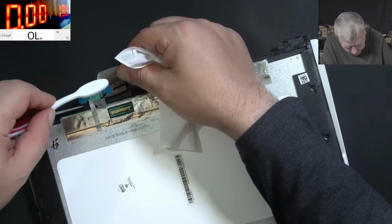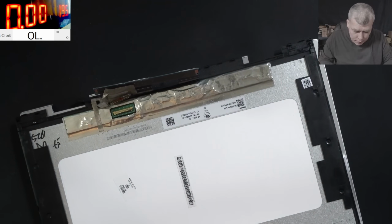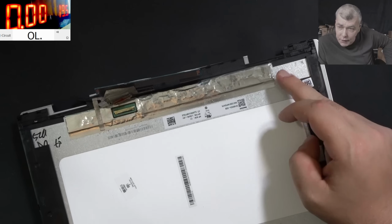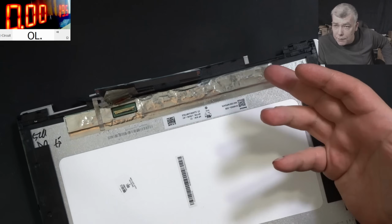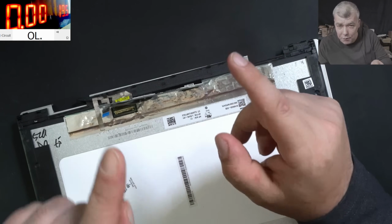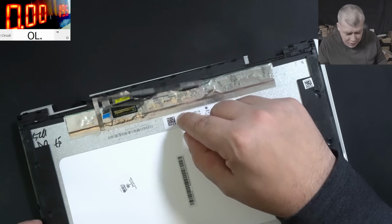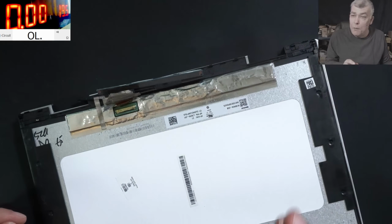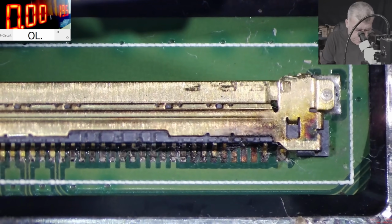So what is the solution for this repair? It's quite easy. You tell the customer he needs another screen and another screen ribbon cable. But that's not only long, yeah? First, you'll start having problems taking out the screen. This screen and the touch screen are stuck together. Okay, you'll say, don't worry, I will buy the screen with the touch screen. When you buy the screen and the touch screen, these boards matter. You will find the touch screen working weird, taking touch on different positions because it's not compatible. I went down that road so many times, you know what I mean? That's why this repair can be done in only one way, yeah? The dodgy way.